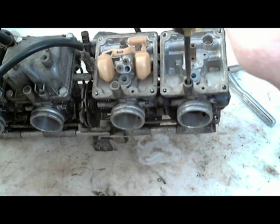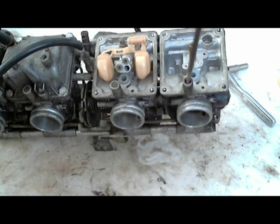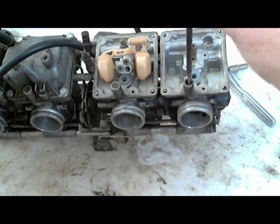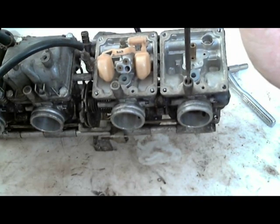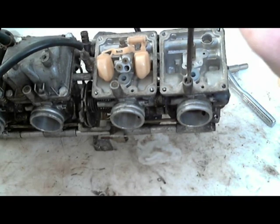Now I'm looking at it and I see the orientation of the top of the screw and the direction the head is facing. So I'm going to count in half turns. That's half, one, half, two, half, three. Book said three, these were at 2.5, or this one was at 2.5.